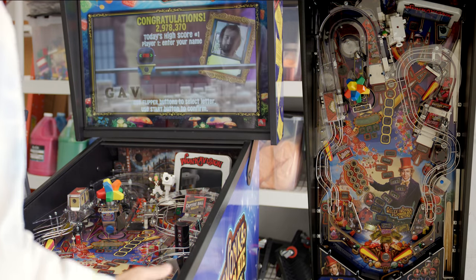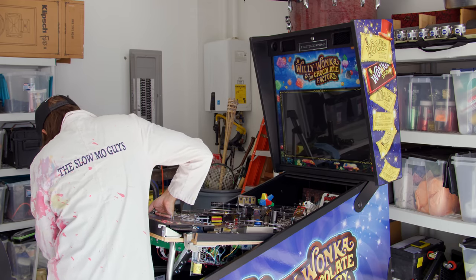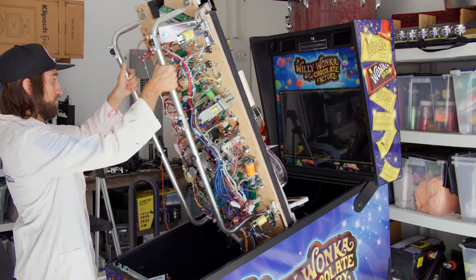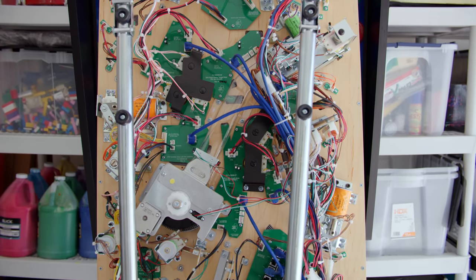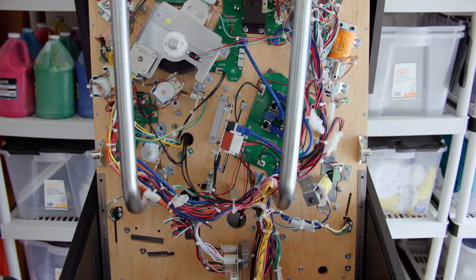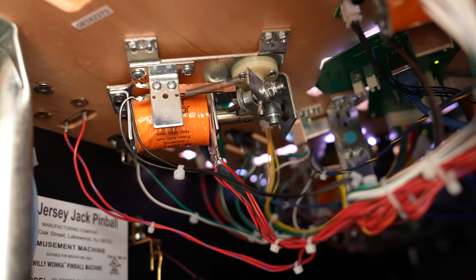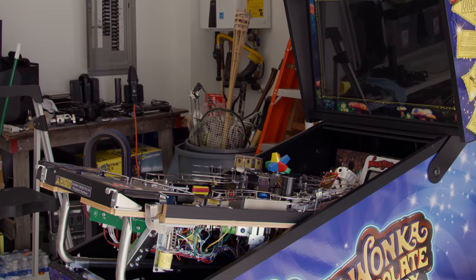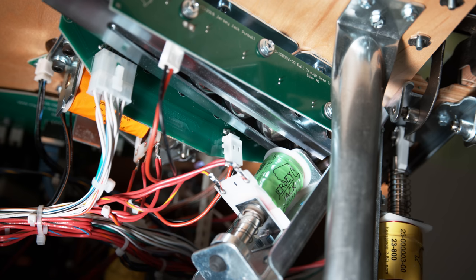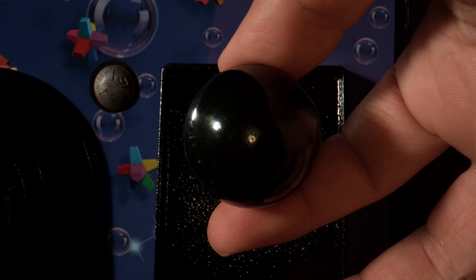If you get the high score, when you submit your name it'll take a picture of your face and you'll hear a little thunk inside the machine — which we'll get to later. To fully show how this machine works I'm going to need to film underneath the playfield, and thankfully you can just pull it out and everything is still fully functional. The most common way for something to move on a pinball machine is through switches and solenoids. A solenoid is basically very tightly coiled wire which, when a current passes through, creates a magnetic field pulling the metal rod through the center. This one is the flipper solenoid and this one is the vertical up kicker in the ball trough, responsible for deploying balls — they work very quickly.